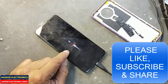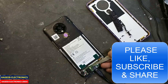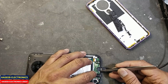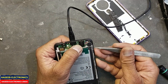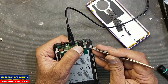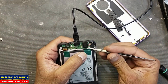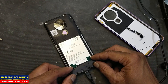We can see the battery was at zero — so it is now charging. Now I am installing this connector. Take special care while installing this connector — carefully align it, place it, press it, and place it in its proper routing. If it is not placed properly it will cut and damage.